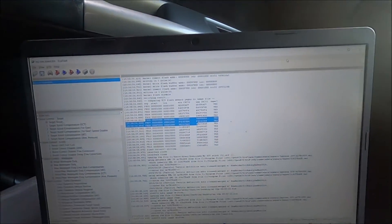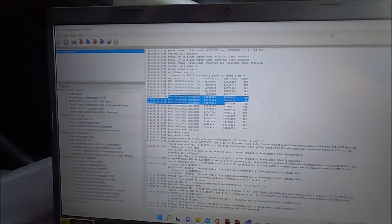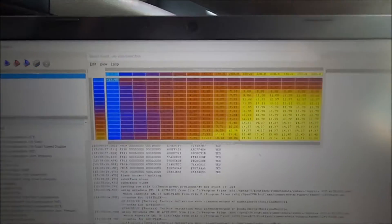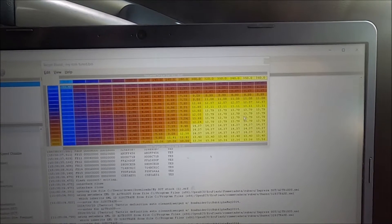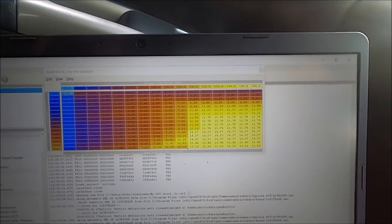To do this you're going to need a few pieces of software. The first is ECU Flash. ECU Flash is a piece of software which you use to pull the ROM — the tune — from the ECU. You can edit it and use it to reflash it back to the ECU. It does all the hard work in the background so that you get tables you can actually understand. For instance, let's pull up the target boost table — on the Y-axis we have RPM, on the X-axis we have load, and in here we have the target boost the ECU is trying to achieve. You can adjust these if you know what you're doing, along with fuel, spark timing, and everything else.